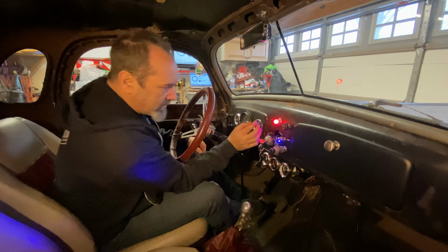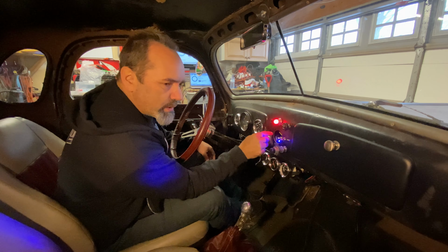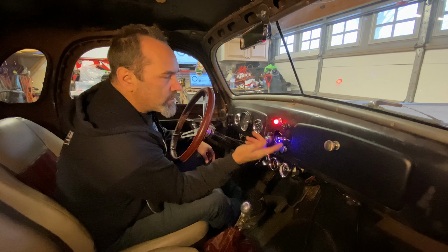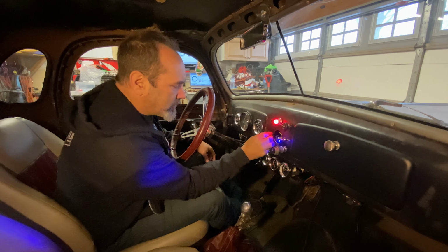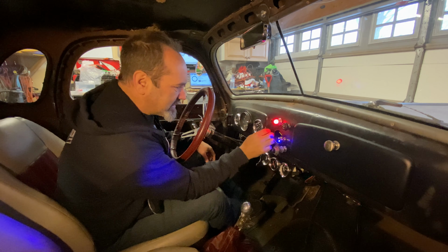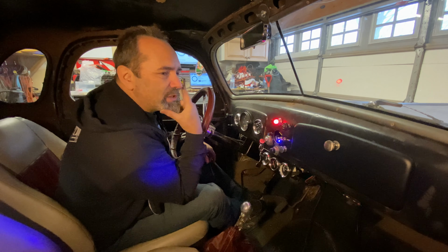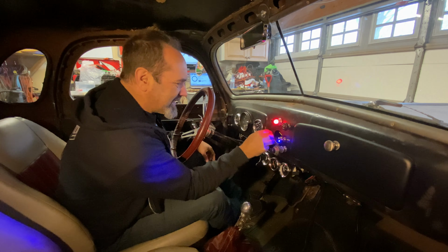The other important aspect of having the control switch, if that was on full power all the time, then it's basically cooling the heater core too quickly. So you're not actually getting the build-up of heat in the first place. So I'll probably run it about halfway. We'll see. It'll be much better when I've got windows, but for the moment it's better than nothing. Should maybe work on the windows soon, eh? Anyway, job done.